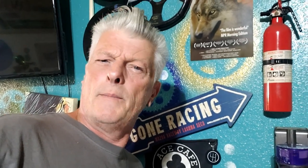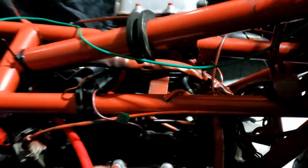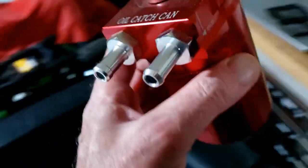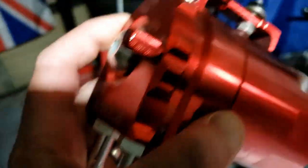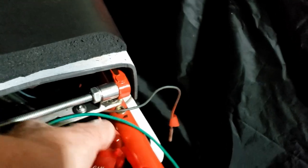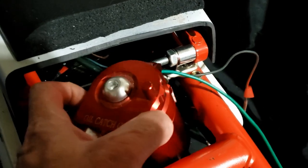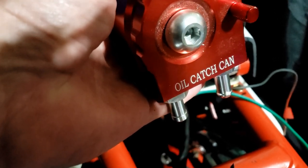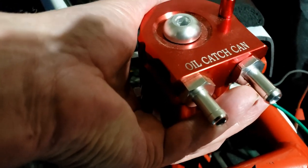So that's about it for the fuel and oil lines. We've got to hook the fuel lines up to the tank — not going to do that immediately, want good access in there because I think we're just going to put the conventional coils back in, which is going to be a fiddle even with the tank off. Other than that, we've got this catch can — I was looking at putting it on our seat mount under there, but the outlets are going to be pointing down rather than the way I wanted. So I don't know if I'm even going to bother fitting it, because essentially it's only vapor at the best of times. We might just dump it on the ground like Moody Goodsy did in the first place.